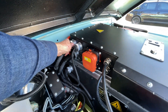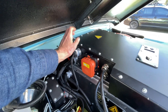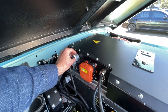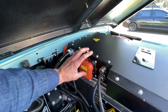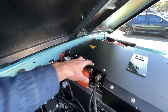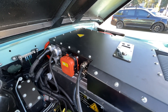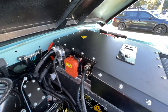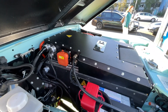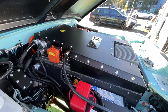Around the side here you can see the connections for the 12-volt systems — 35-pin Deutsch plugs. This is the BMS that runs around the car. This is the CAN bus and control for all the battery pack, and a manual service disconnect fuse. Pull this fuse and the entire system is disabled — battery systems are turned off, all contactors are open, and the system is really safe. OEM-level equipment in a package that can be bolted into a Series Land Rover in approximately 15 minutes with about five cables to plug in.